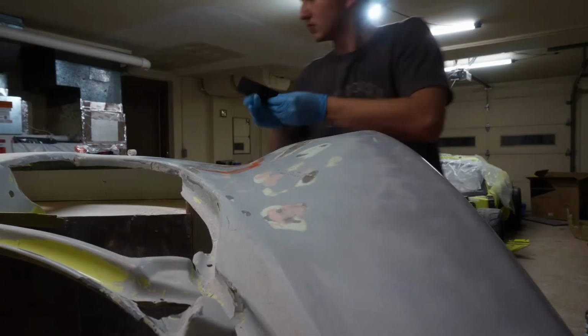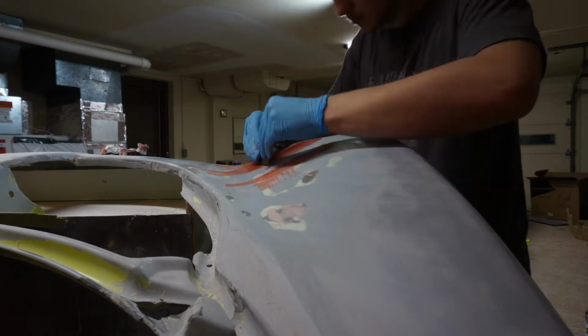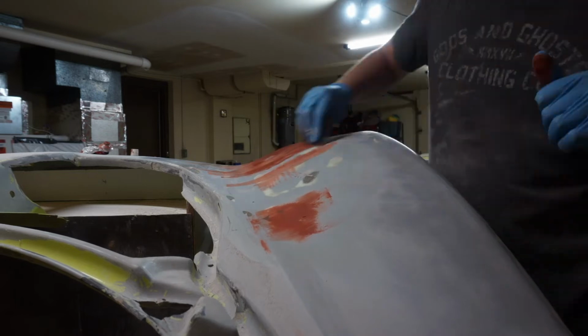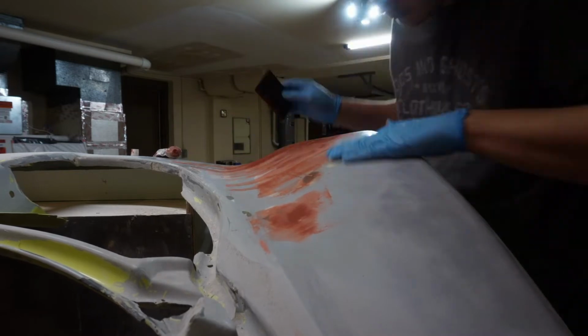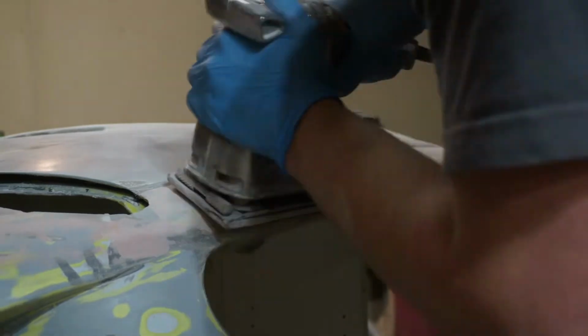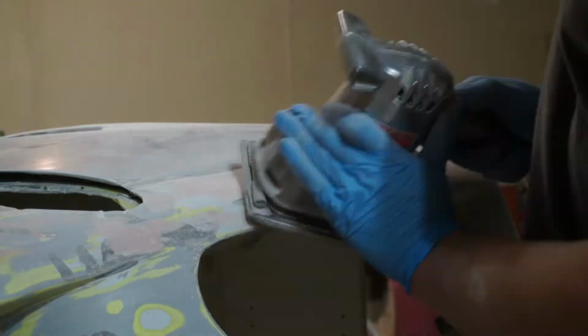One of my strategies I came up with and started adopting when learning to work on this car was taking red spot putty, or glazing putty, and covering the whole surface with it that I repaired, and then I'd sand it down so it only filled a very thin layer of the otherwise uneven surfaces. Due to how easily this sanded, this added step really laid out a smooth curve without divots from the change in the surface across the repair areas.